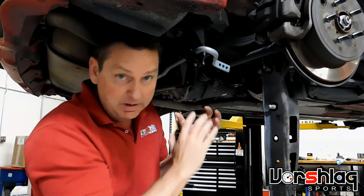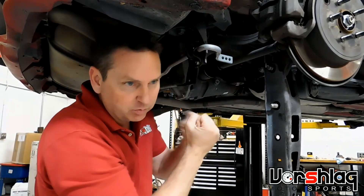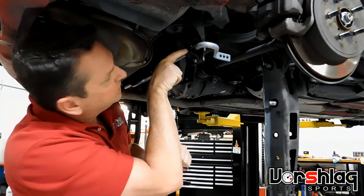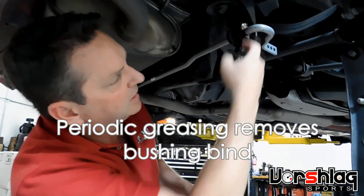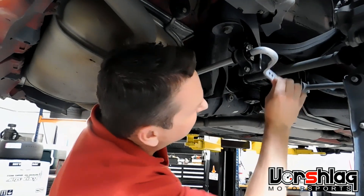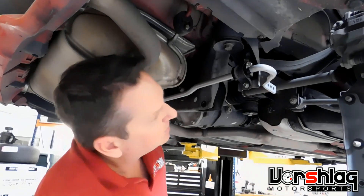This one isn't as bad as most we've seen, but when they lock up in these mounts, it's just twisting this part here — it's really stiff and adds a lot of spring rate. So we'll shim this, drill a hole for a greaser all the way through the bushing so we can grease the inner surface of the sway bar where it hits the bushing, and then we'll have that perfect pinky effort. It's about triple of what it should be, so we'll free that up and free up the suspension to do the work we want.